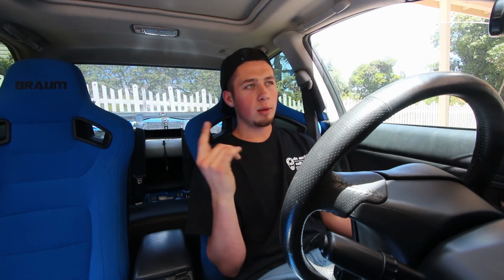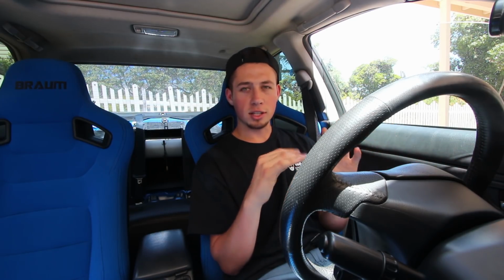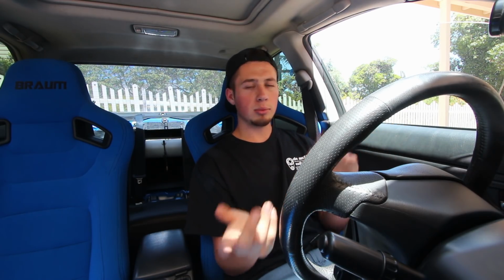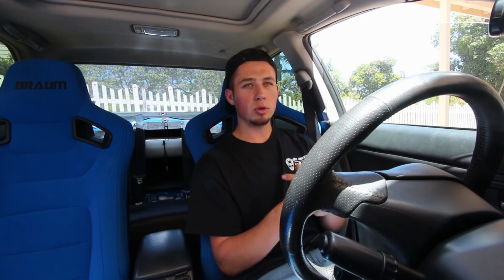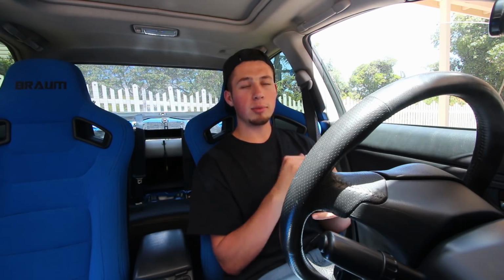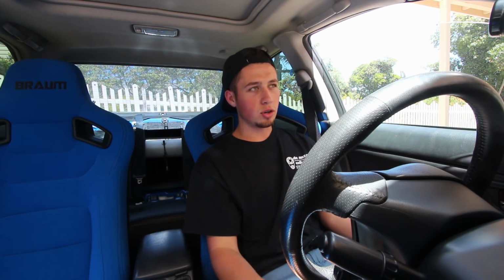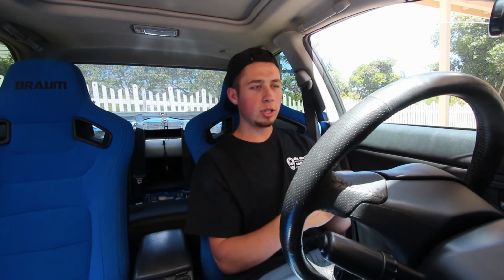I also did get rid of my Denso plugs. I no longer have those. I bought some OEM NGK iridium plugs, the best ones they said for Subarus. They're not one step colder or anything. I think I will go one step colder eventually when I get my tune. But I got my different plugs. I'm not going to put them in yet until I replace that gear, because I don't want them to get fouled. So I got those new plugs, new gear coming in.